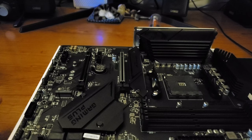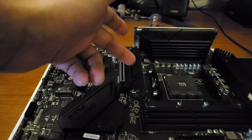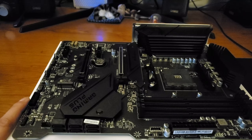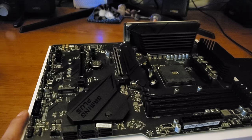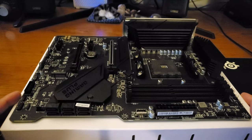Even though, I'll be honest, let's say for example you have a 970 Pro and a 980 Pro, I actually did a quick 2-minute video of data transfer between two of them. You really won't be missing out too much. You get 3 gigabytes a second speed as opposed to 5. It won't take you that long to copy over 52 gigs. So pretty excellent layout of the board.